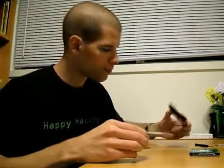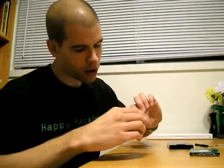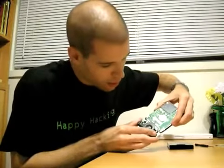Okay, so the first step to the process is to install this hard drive, which is now unpackaged and ready to be installed, into the enclosure. Then you've got a screwdriver and some screws to complete the installation. So first we open the enclosure, and you need to take off this little warning label. It says the hard drive must be formatted, so we'll peel that off. This enclosure doesn't require any screws to install the hard drive specifically. It just fits into this controller board here, and so we'll just slide that in.